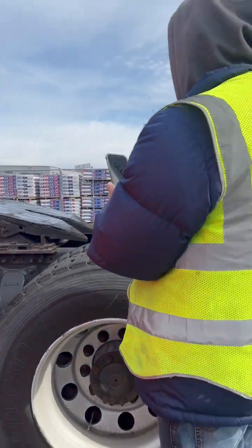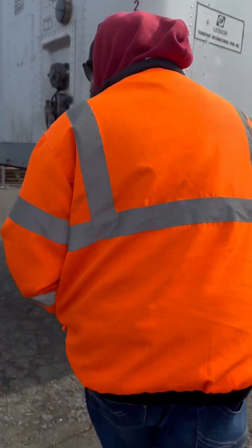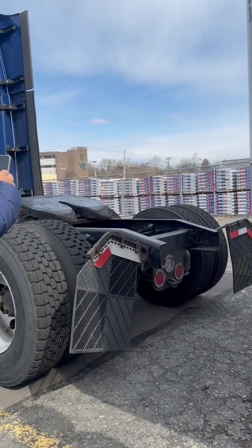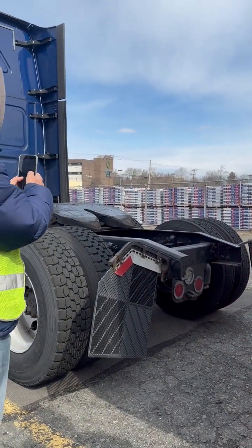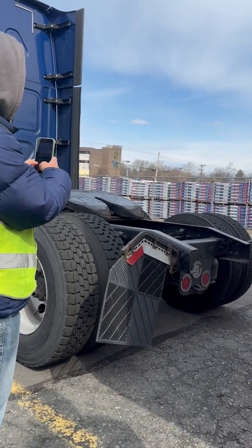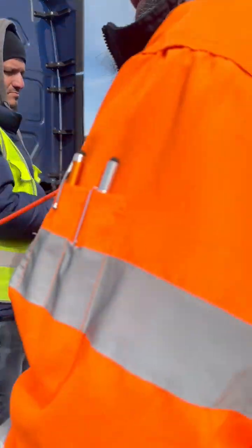Then you're going to come to the back. Look down, you're going to say, looking down the throat of my 5th wheel skid plate, I can confirm that the locking jaws are securely around my kingpin. All right? Any questions? All right, so let's go over here.